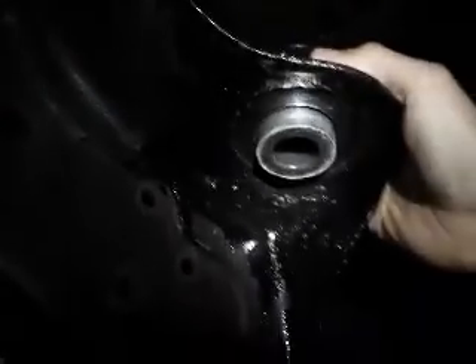So what do we do about the fact that the bushings don't stay up anymore — they just slide through the rusted frame bracket? Go to your local metal supply place and get four of these large washers for a one-and-seven-eighths inch bolt. They cost me five bucks for four. The hole in the middle is two inches, and that's exactly the diameter of the bottom of these top bushings. Put this on your frame bracket and now when you place a bushing up here, it will sit perfectly.